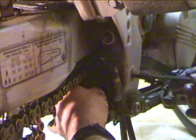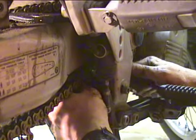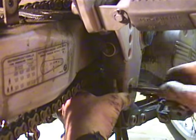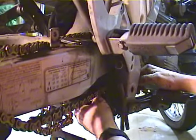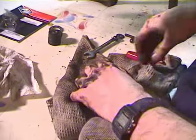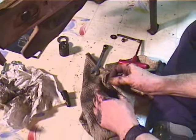You've got to make sure you don't lose anything. I've got the nut out, and there's the bolt — washer, bolt all the way out. And now here's the roller. A lot of parts here. So for this roller, I'm just going to lube it. You can see that this one doesn't get hit by the chain much because this is the lower roller.